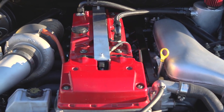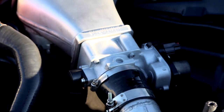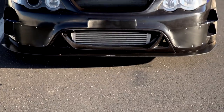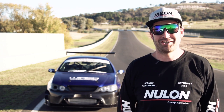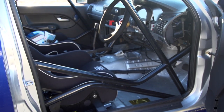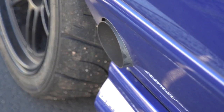We've stayed with the falcon 4 litre and T56 gearbox. We put a Plasma Man inlet manifold — just the top half — and a Plasma Man cooler, sourced from Impossible Fabrications at Moorebank. They've pretty much helped me build all the fabrication work on the car: roll cage, setting up the rear end, mounting it all, all the intercooler piping, exhaust manifold.